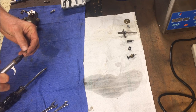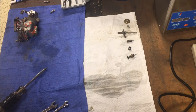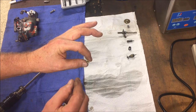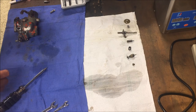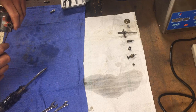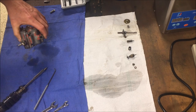When you are inspecting a jet, you want to hold this thing up to the light and look in it — have a light behind you — and you want to see a perfectly round hole. No fuzzy stuff, nothing in there at all. Don't take a drill bit and clean a jet out; they make some tools specifically for that. They're easy enough to clean usually. There's a little gasket in there — give that a little blow.